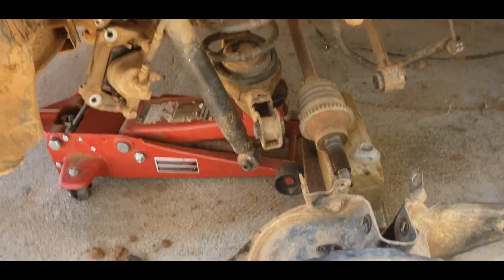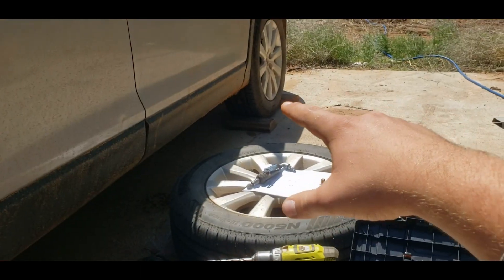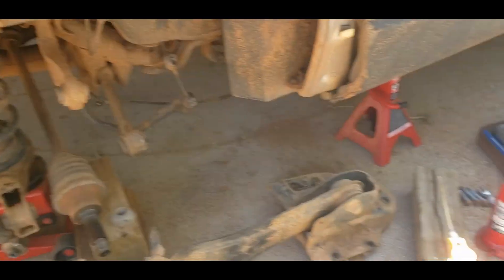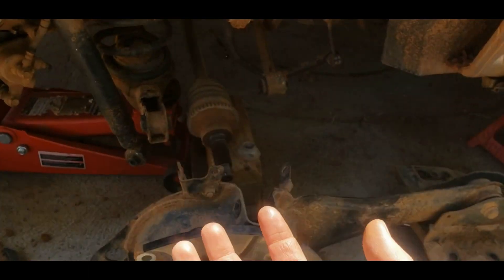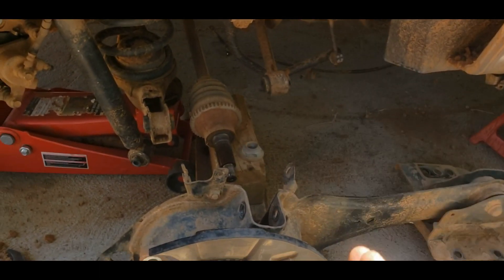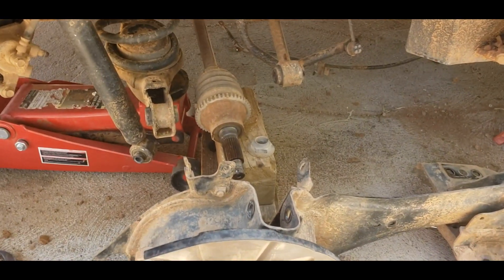Here's the order of operations for how you should get this off — just my opinion. First thing: jack up the vehicle. You're going to want a good floor jack, a couple of good jack stands, and plenty of blocks. Block your front tire so it doesn't roll. Don't set your parking brake because you have to take the parking brake off. A small bottle jack is handy — that lets you get directly underneath and once it's loose from stuff you can push it up and keep it square to the CV axle so you can drive the spindle straight out.